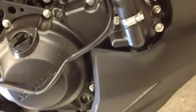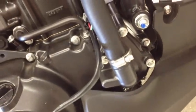So run the wires down here, across here, and you'll see it'll be easy access to get to that oxygen sensor if I ever need to. There's no easy way to run it underneath here. No real easy way, at least. And plus it'll help keep the road grime off. And you want it up higher than the edge of this right here. So you'll see when I put this back together.